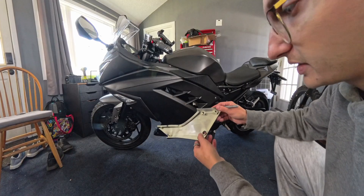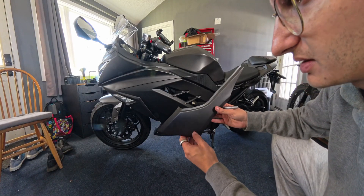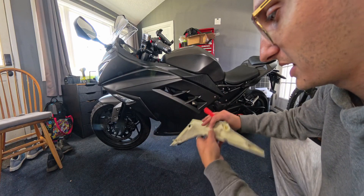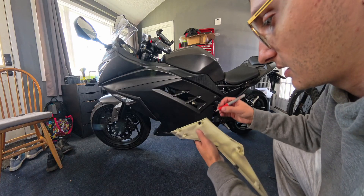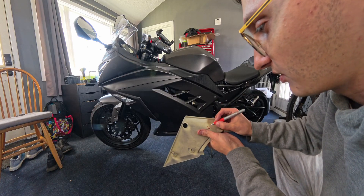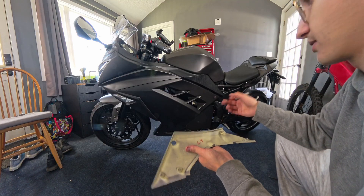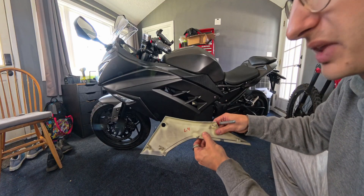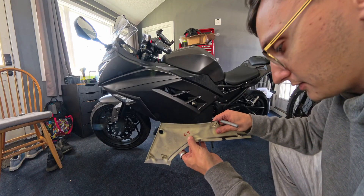The parts you saw falling off right there were the inside of this mounting point — this happened on the other side too, so I think it's just going to be like that. To make my life easier later, I'm writing on the inside of these which side they're on and the opposite order they need to go back together. There are four parts; this is the last one that needs to go on and it's the left side, so I labeled it L4.